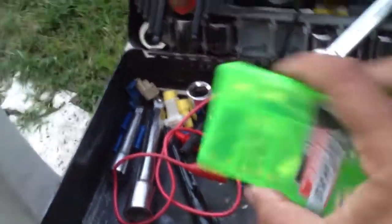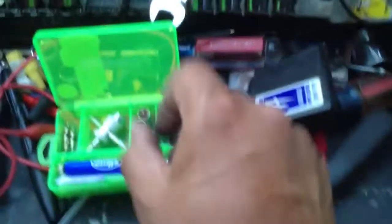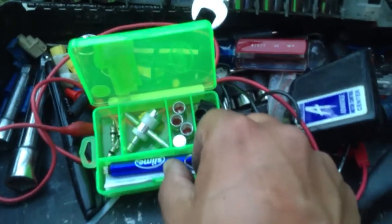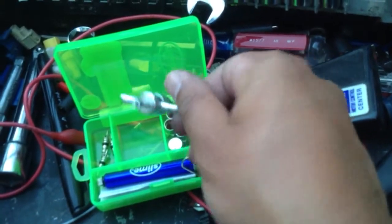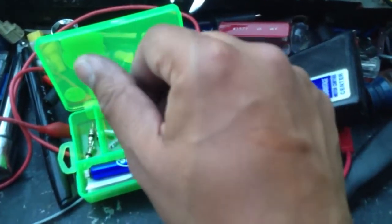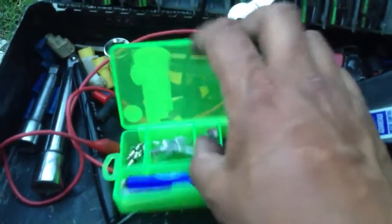This here is a cool little item I got at AutoZone. It's a little kit that has a tire gauge — costs like three bucks. I needed this when I was running my motorhome and had a bent valve stem and couldn't feel air on the tire. This is a valve core removal tool — stick that in there, turn the valve core around, and you can do this when the tire is still inflated. If you work fast, you can put the new valve stem in and tighten it down without losing all your air. Useful thing to have.